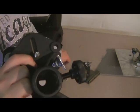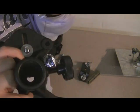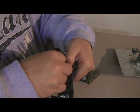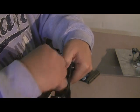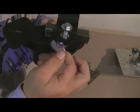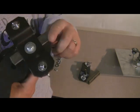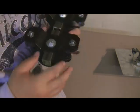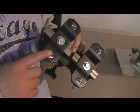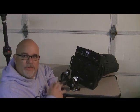I put a fender washer on the bottom, a lock washer, and the nut. Now it's spaced off just fine — plenty of clearance. Do the same to the other side. You can choose to paint these black if you like — kind of blends it all in. One tripod mount for the Visi Beam. The last step is to match up these holes with the Visi Beam and tighten it all up. The most important step is to line up the plate with your tripod mount, so make it snug but don't tighten it up until you make that adjustment.